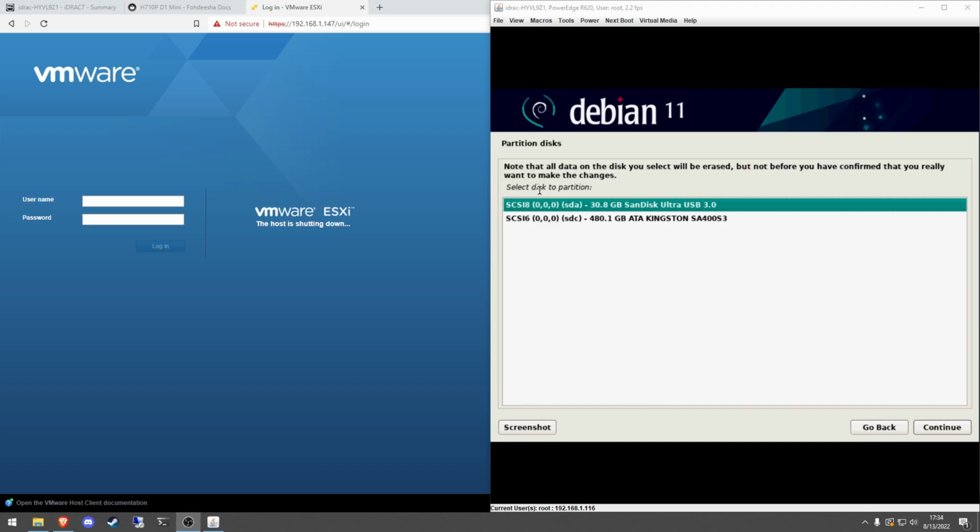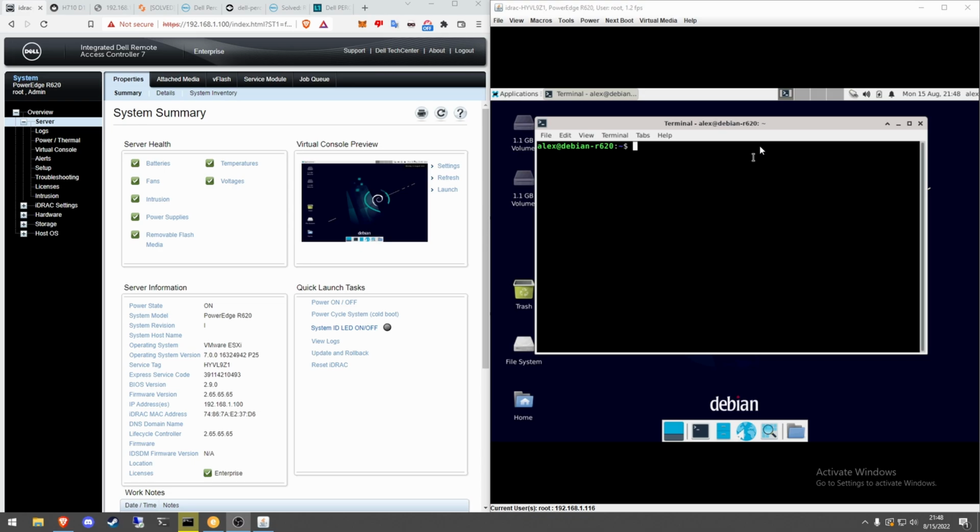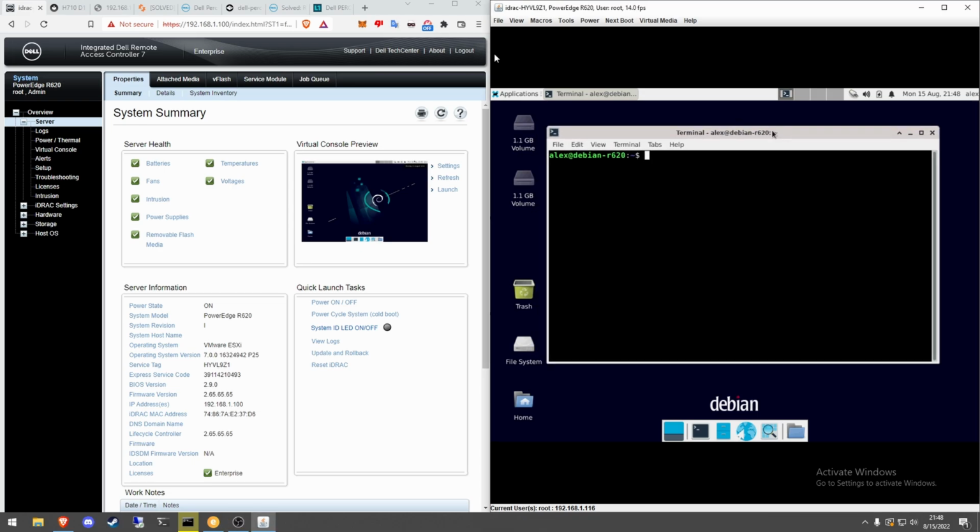Alright, I'm here another day, and I've done quite a bit of troubleshooting, as you can probably tell with all my tabs open here. I can't tell why that hard drive won't work in my setup. I took the SSD out of the server and stuck it on the back plane, and that worked. So I don't know why it only detects SATA drives, because the controller itself should be able to support SATA and SAS drives.